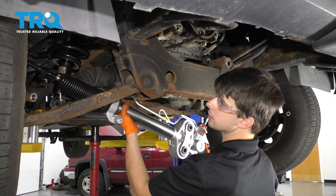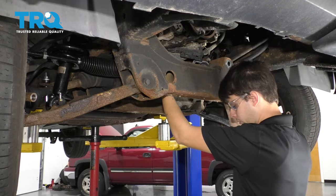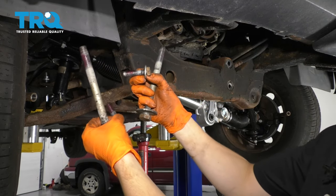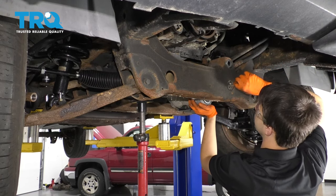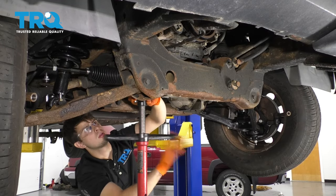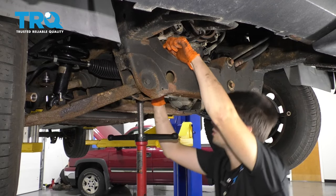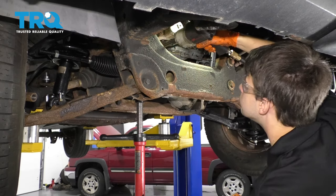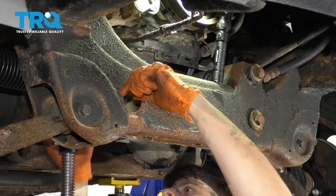To put the new one in, just reverse the procedure. Slide it into the passenger side, and then on the driver side, a couple of twists. Once you have it close to where it's supposed to be, support it with something. I've cleaned up the threads of all four bolts and applied some red thread locker — very important because this component sees a lot of vibration and you don't want these to back out. Start one bolt in on this side, then start the other one. It's important to start the threads so the bolts don't fall out and hit you in the head. Line up the smaller ones and adjust the bushing as needed since it can slide on the rack.